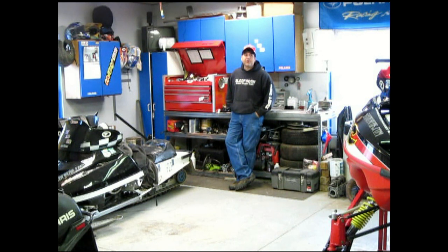And we're also going to put in a Speedworks clutch kit today. From what I've read, the perfect setup is a Speedworks yellow spring and I believe 64 gram weights, or close to it. So we ordered up a kit. I got one here. We're going to put that in. And it also said about changing your jets to 410 mains. Well, with my Holtzman Temperflow in there, I don't have to do that. It's going to do it for me. So I won't have to do that. So let's put the clutch kit in.